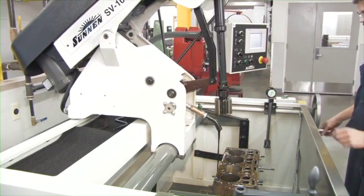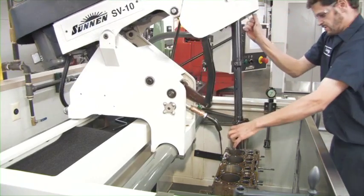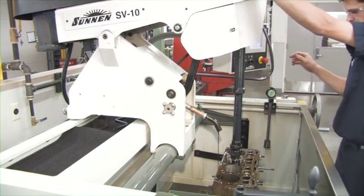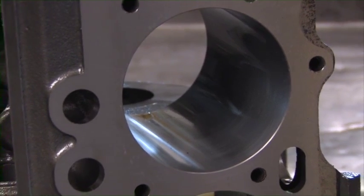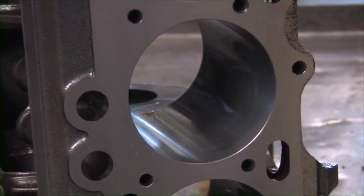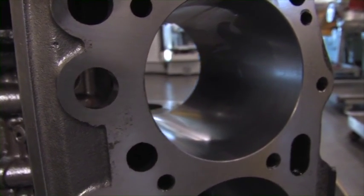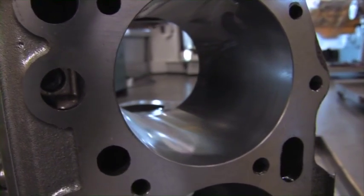Oil consumption occurs in engines when there is a poor finish or inaccurate size in the cylinder. By utilizing the diamond head and computer readout, it assures us of a perfect finish, which is known as crosshatch. This allows for proper piston ring to cylinder wear to match manufacturer's spec. Oil consumption and emissions are non-existent with proper cylinder sizing and finish.